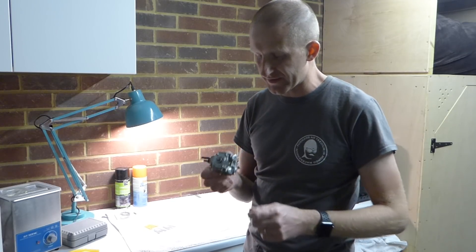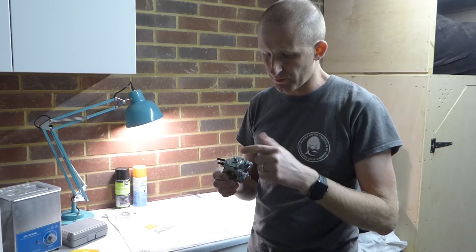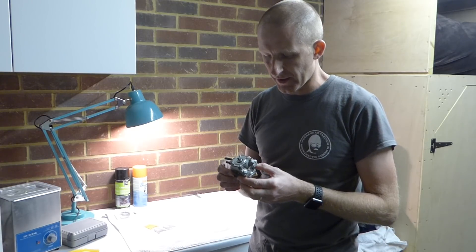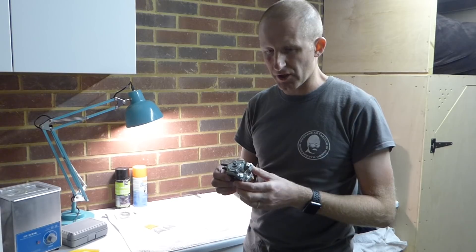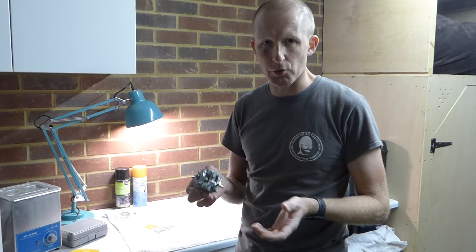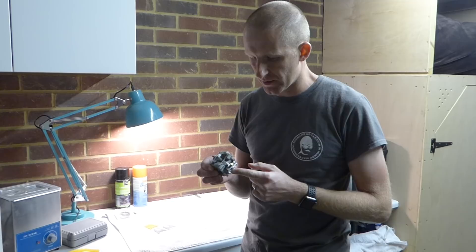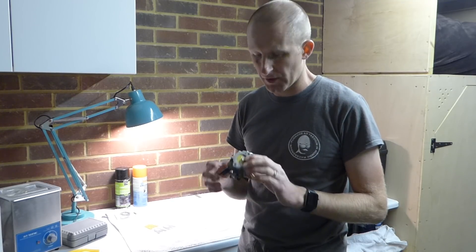There's definitely something wrong with this one because the machine was able to prime the fuel into the carburetor, start the power motor, and then shortly after it would just stall — almost like fuel starvation. It's probably an issue with the fuel pump side not pumping the fuel through correctly; maybe there's a blockage, I don't know.